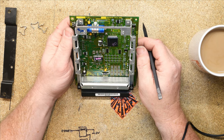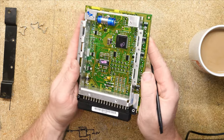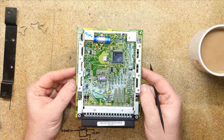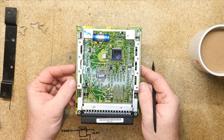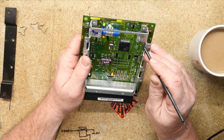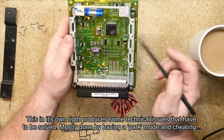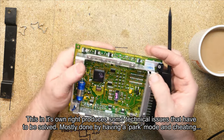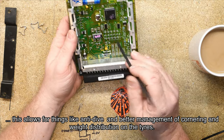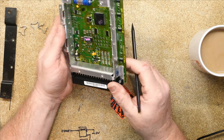These don't have a gyro or accelerometers. So when I say self-leveling, they will level all of the suspension bags to the same height. For example, on a flat surface the vehicle will sit level, but if you park on a slope you'll sit off at an angle. It's not like the more advanced system used on Audis of similar age where they actually know whether the vehicle is level. We have our microcontroller, and we have 74HC logic chips being used as buffers or inverters, most likely to drive the transistor arrays which are almost certainly driving the solenoids.